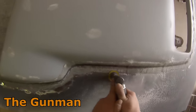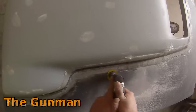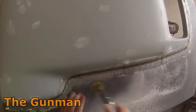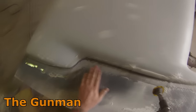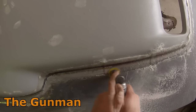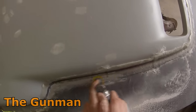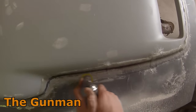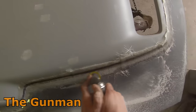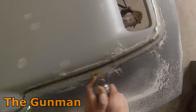What I do know about fiberglass is it is a very hard surface — a lot harder than any body filler or anything like that. So if I just tried hand sanding over this with a block, it would take forever. That's why it's a good idea to use some sort of machine grinder to grind most of it down, because even an orbital sander will really struggle with fiberglass sometimes.